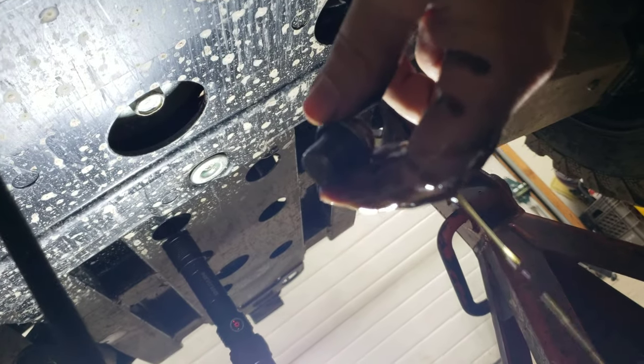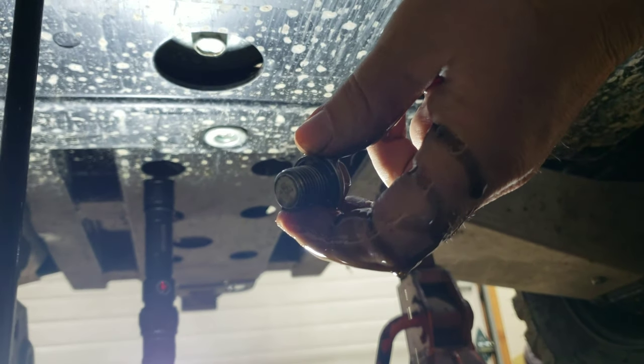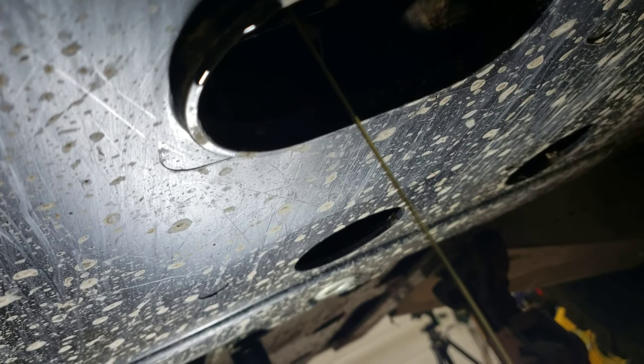Okay, and let's see here. The oil is nice and clear. You can see it draining. The oil's not super dirty. So at 20 hours, the diesel soot hasn't really taken it over completely. Let's see, can we see any light through there? Right there, you can see the light through. So you can see that oil is not blacked out. If you have ever had a diesel truck, you see diesel oil, man, it's like within a couple hours of starting it up, the oil's trashed. So there, you can kind of see the golden brown color. It's surprisingly clean compared to what I expected, right? I thought it was going to be a lot worse.